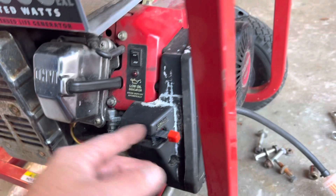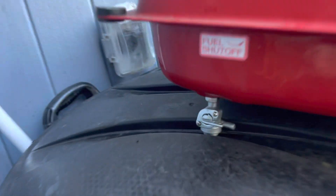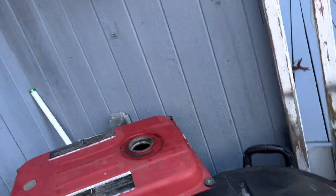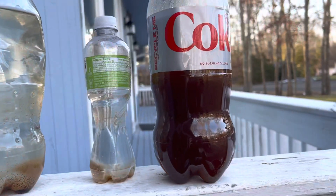I bought a carburetor and put that on — 12 to 14 bucks. I also bought a filter and the petcock. I changed the petcock because I knew from the dead gas in there that it would be clogged. This was the old one — it doesn't even have the filter on it anymore; there's supposed to be a filter piece on it and it wasn't there, so that's garbage.